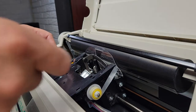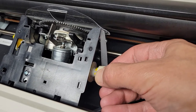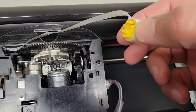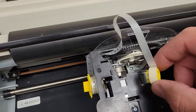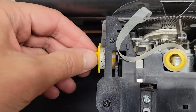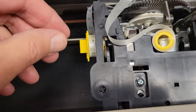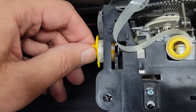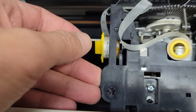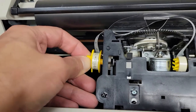To change it out, it's really a simple matter of pulling this off. The feeder spool lifts up and then you can set it down. The take-up spool is locked in place but there's no screw or set screw — you just pull it off straight and you'll hear a snap as it gets released. Hold the carriage to avoid putting too much tension on it, then grab this and pull it — see how it popped right out.